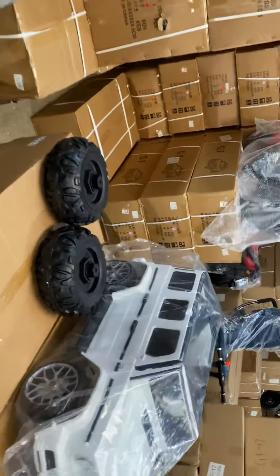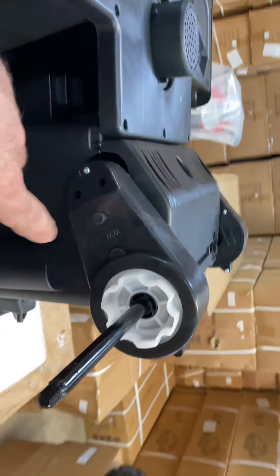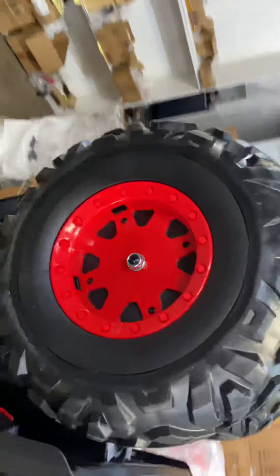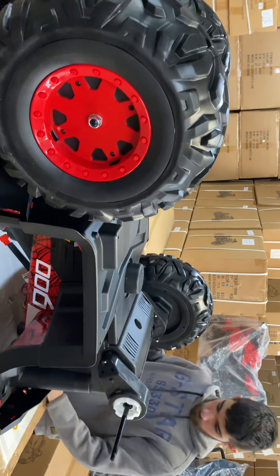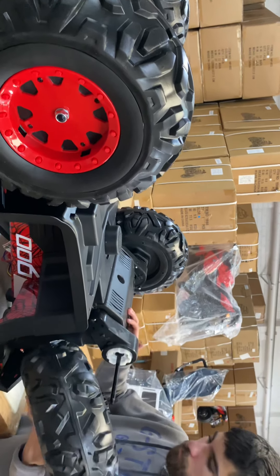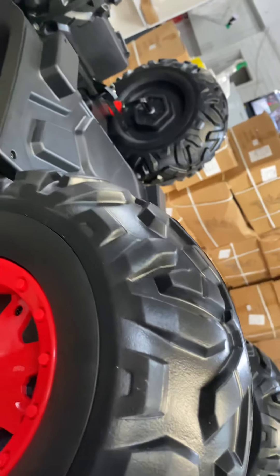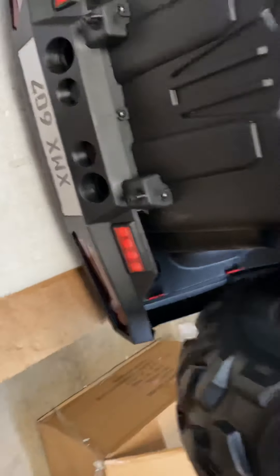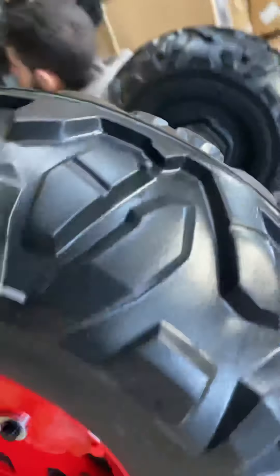For the back wheels, those wheels come with this flange for the motors. This bike has two motors. Put two washers outside for each wheel — two washers together, nothing inside — only outside the wheels. You put two washers and one nut.